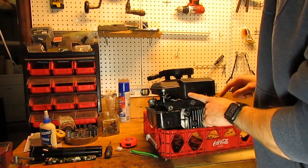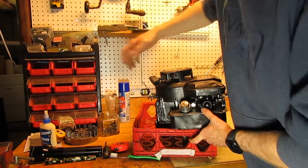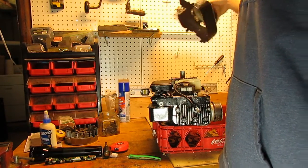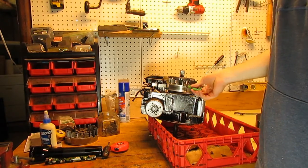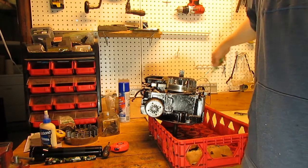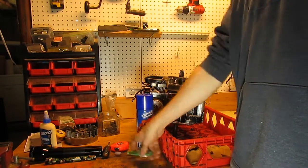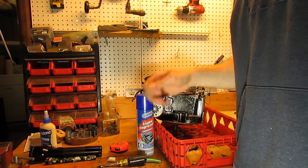On the blower shroud, there should be a couple of screws that attach it. The newer ones are even more simple to take off — they usually need just a couple of flatheads. If this comes off, you can see the flywheel. You don't want any dust inside here, so just go in and clean it all out. Things like dust and dirt — a simple brush, a screwdriver, and a little thin piece of wood to reach into those fins — are going to be your best tools.